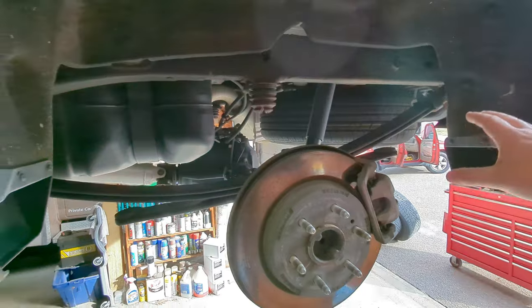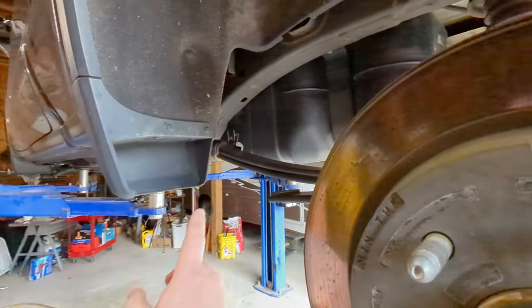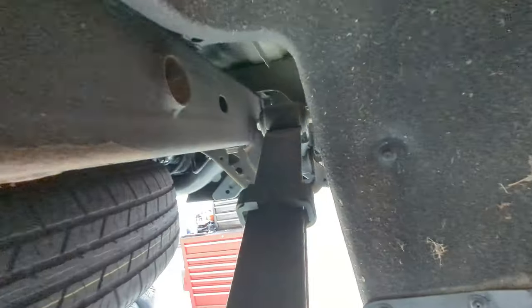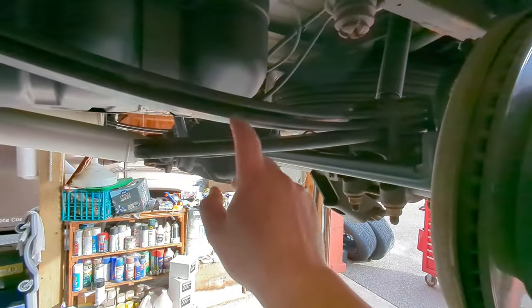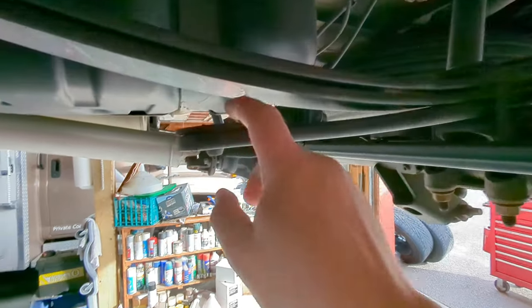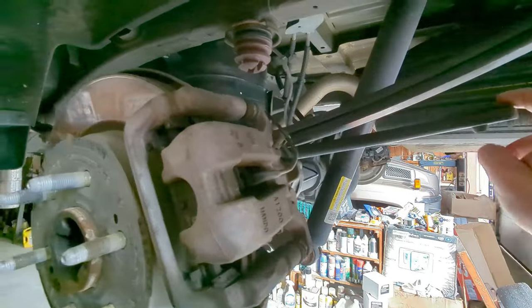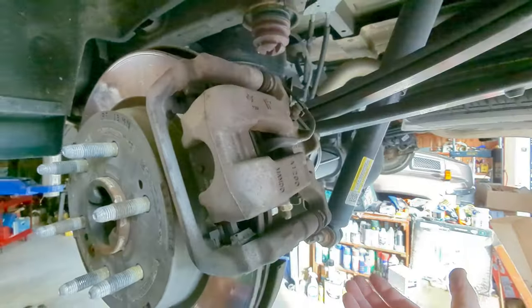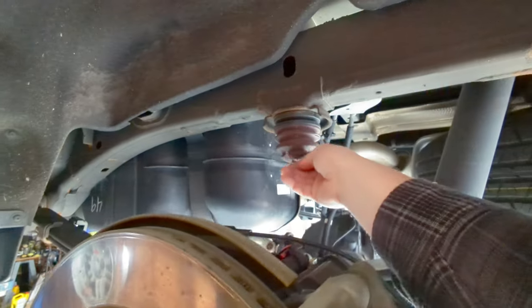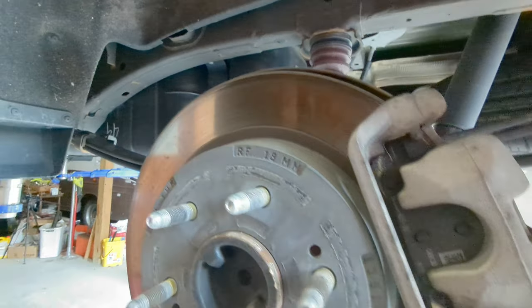The leaf spring pack is a pretty soft pack on the back — you've got two full-length leaf springs that go from front to rear. You can see all that connected, and then you've got a third helper leaf with a little rubber isolator on the back. Now if you start running into the bump stops, that's that piece right there — when the axle goes all the way up, this is going to act as a secondary spring to basically absorb some of that extra shock.